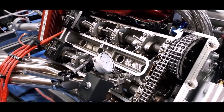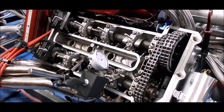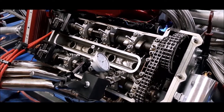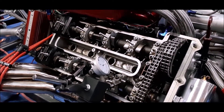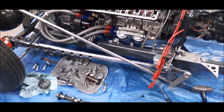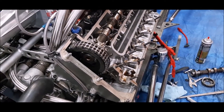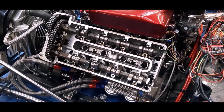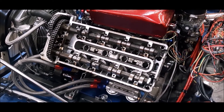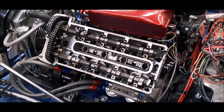The plan here is to set the cams up like factory using cam locking blocks, then measure how much lobe lift on the lifter face is present at cam overlap top dead center with a dial indicator. I measured roughly 15 to 18 thousandths lift during overlap, then physically move the exhaust cams to the intake cams location, and vice versa for both banks. To set up the new cam timings, I decided to go with 15 thousandths on both intake and exhaust at overlap. It's a crude way of setting cam timing, but it works.